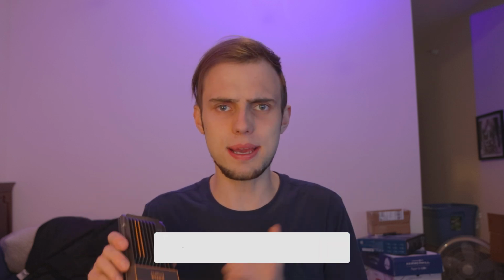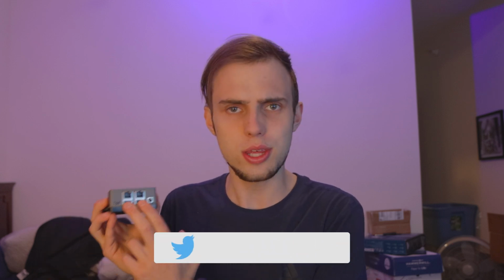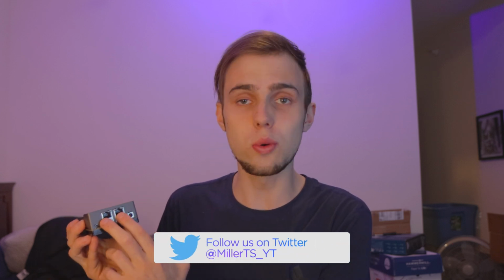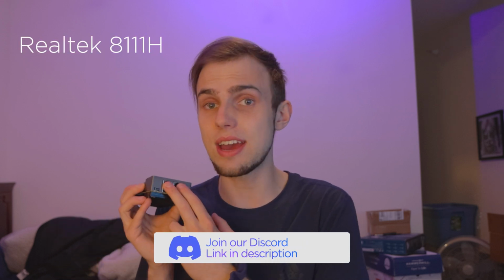What's up guys, Jack here with MTS, and this is the Zima Board, a low-power single-board computer that's full x86. And this guy is basically a Raspberry Pi on steroids. You have dual USB 3.0 ports, dual gigabit RJ45 ports running a Realtek NIC, which I have had no issues getting to work right out of the box in pfSense, Proxmox, Windows, Ubuntu, and FreeNAS, or TrueNAS Scale.